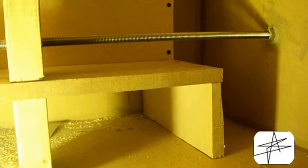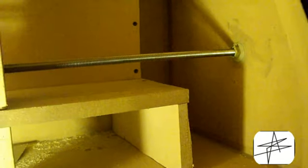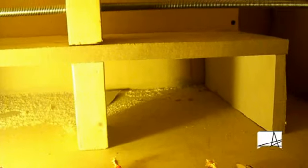I'm going to start fiberglassing the whole inside of the box, pretty much as much as I can, and mainly fiberglass that port in. It's going to add about 11 and a half inches total to the port, so I'm going to be right at around 32 hertz. That's what I'm shooting for — hopefully it'll sound better and get the lows I'm looking for.